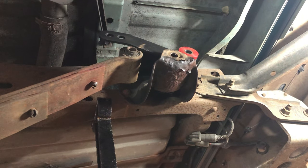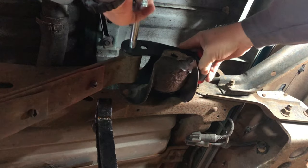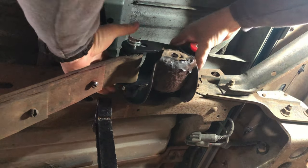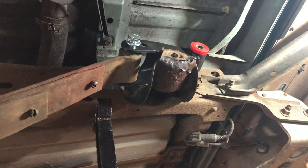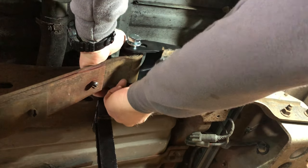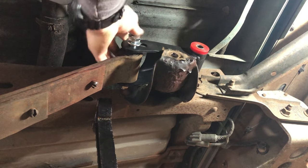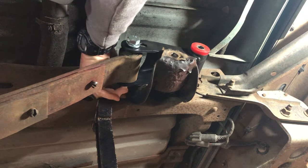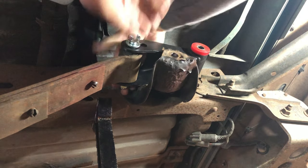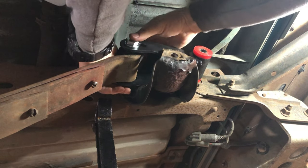Here's the Loctite. What I'm going to do first is get that fed through there. Get it aligned. Yeah, we got plenty of thread. I'm just going to put this nut and this bolt on the backside just temporarily, and then right when we get ready to torque them down, we'll put that Loctite on them. But this way it'll hold it in place while I try to wiggle this axle back in. It said you got to put weight on them before you tighten them down anyway. Yeah, once it's sitting on the ground. And this one's 25 pounds. This one's probably the same thing.